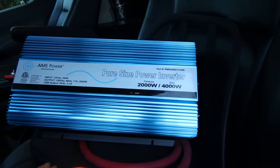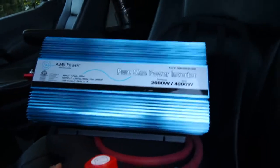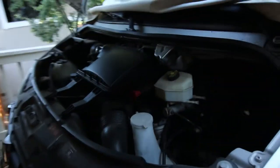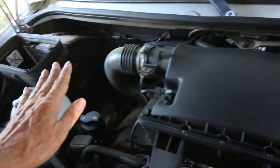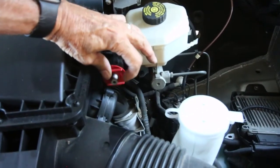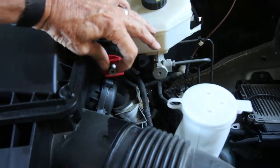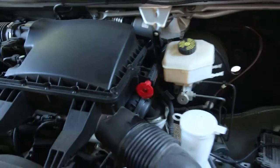It might get a surge for a little bit more, but don't run that very long — that might be if you were starting up some kind of appliance. So how are we gonna do that? We've got to get power from somewhere. One way is we can try to get it in the cab here. The battery isn't here, but there is access when using the compressor with an alligator clip. It takes more than a cigarette lighter — there's some access to 12-volt power there and you can get a ground anywhere.